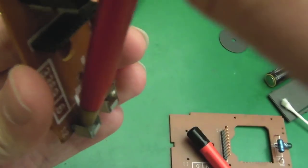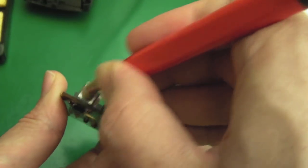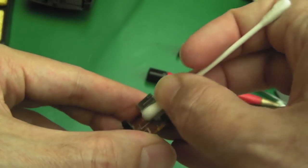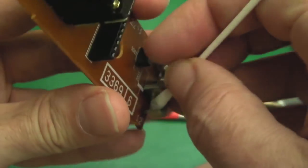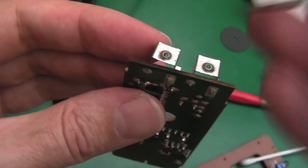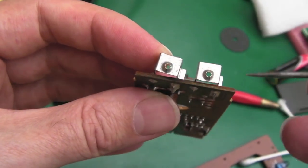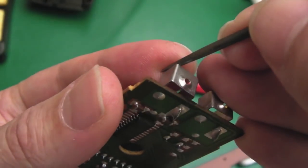I might need to use the wire brush there because there's just a little bit not coming off. So up a notch in terms of abrasiveness — let's get the wire brush onto that, and then we'll go over with the fiberglass pen again afterwards. On the inside as well, because there's a fair bit there. And the fiberglass pen here just to finish it off, and a final wipe down with IPA just to get any contaminants off after I've been scrubbing and using the brush on there.